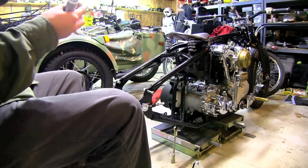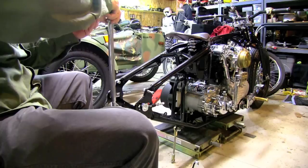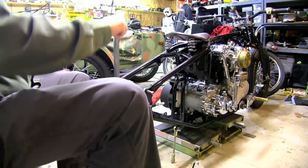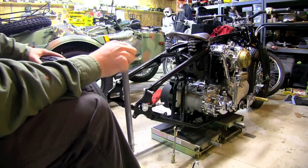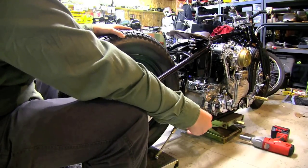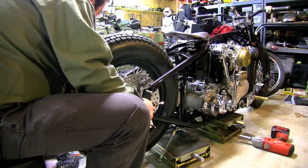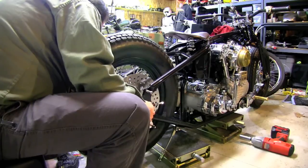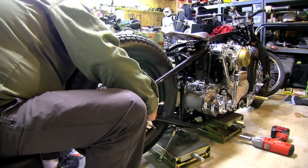Get it through that - do this without making a huge mess. Fumbling around with the rear tire while trying to put all this on isn't going to be the simplest thing to do. I got the front jack lifted just right where I can manipulate the axle myself. And until I get my chain out and on, slide the castle nut back on there, put the cotter pin in so it stays in place.